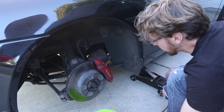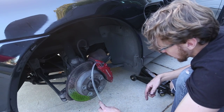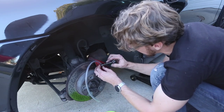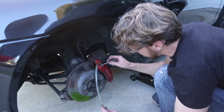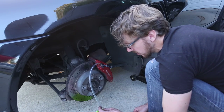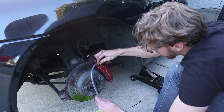I have my bucket for the old brake fluid. I'm going to remove this cap right here — this is why I have this little length of plastic tubing, because the old brake fluid will squeeze out here. I put the tubing right there. This is where I use my 11mm wrench, put it right here, and just go ahead and loosen it. The brake fluid should just drain out nice and easy like that. With the power bleeder you can just let that drain. When you've drained a good bit out — maybe a cup of brake fluid from that one — go ahead and tighten that down and pull the plastic tubing off.